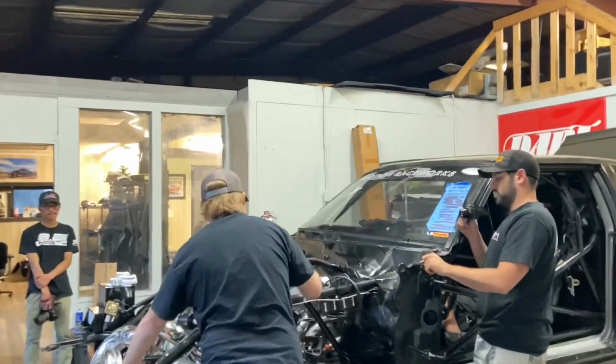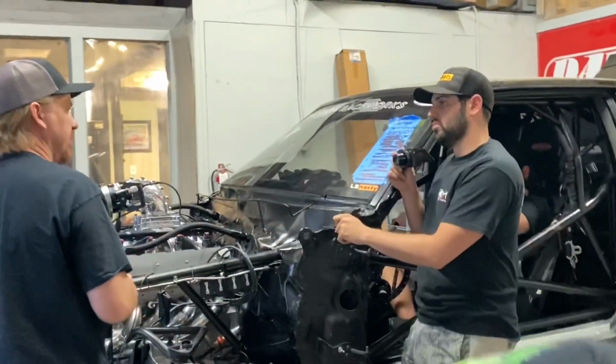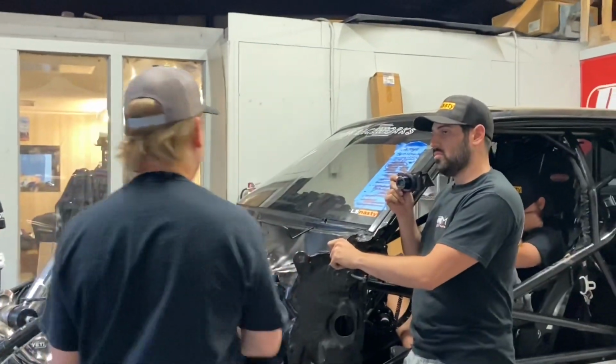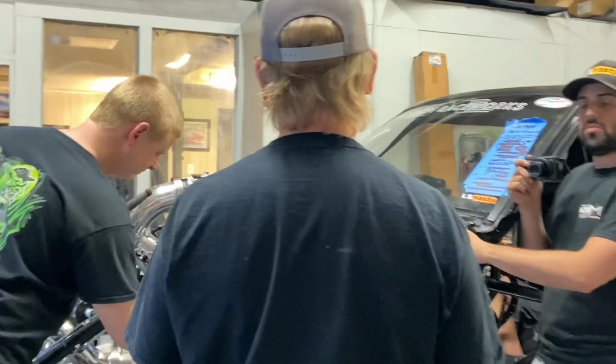Essentially, with the Holley, the cam and the crank have to coordinate in a certain manner. So if you set your crank signal at 60 before top dead center, then the cam has to fall at 195 before top dead center in order for it to start the cycle in the right place. With an LS motor, you can't adjust the cam signal. So the problem we have is obviously the cam signal is not at 195 before top dead center. So it was starting the cycle over at the wrong cylinder. We checked the timing, it was like 180 degrees out. Problem is we have no way of moving the cam sync.